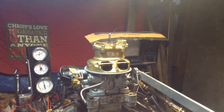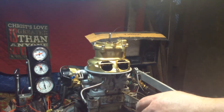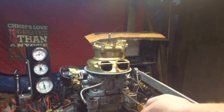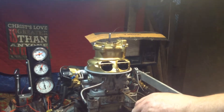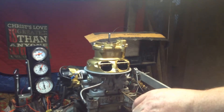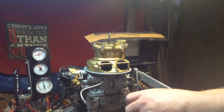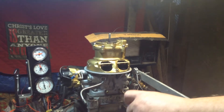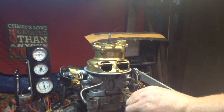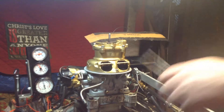Okay, see what it does, Mr. Mixture Screw. Note where it's at. I didn't do it with the screwdrivers so I can count the turns. Do you want me to go in or out? Go in. That's closed off — okay, take a while. That was about three quarters.